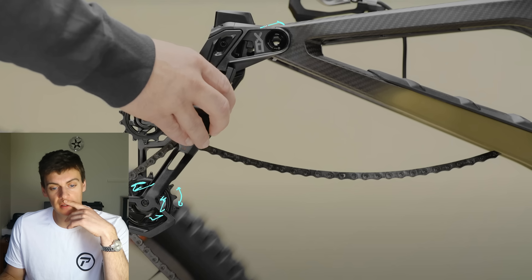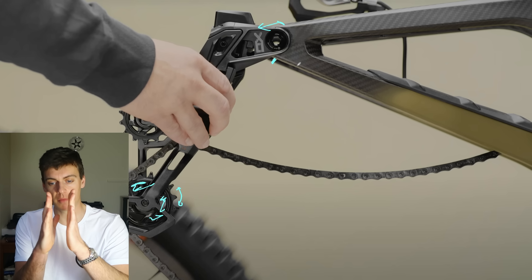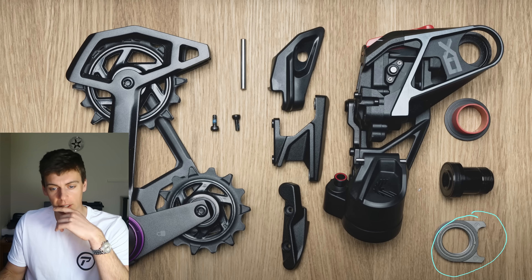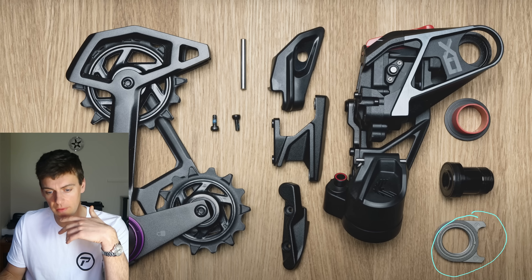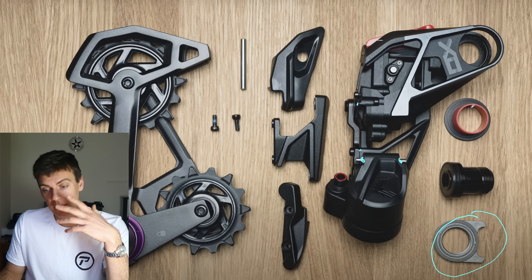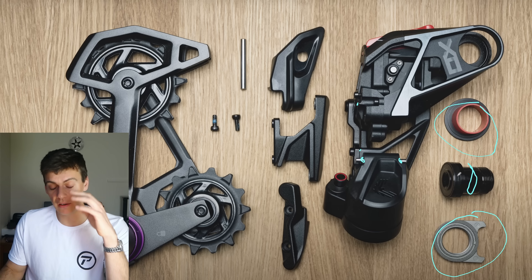When you get the bike in and out of the frame, this twist is fine as long as that serrated washer doesn't move. But like I said, if a frame comes out slightly too narrow, the mech is always going to be sloppy. There's also a large bushing here — obviously mechs are full of pins and bushings — and that large one is effectively the axle for the mech to rotate about.